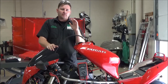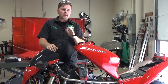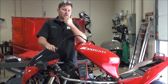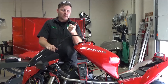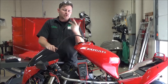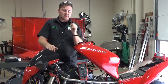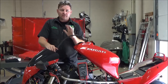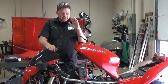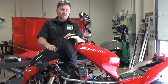I'm going to demonstrate today that we can use a voltmeter when we start a motorcycle and do three different tests. We're going to do surface voltage — that's what the battery is with no load on it. We're going to do a load test to see how far it drops down and give you some specifications for that. And then once the vehicle's running, we'll do a charging system test without moving the meter at all. We're also going to show how something can very easily be misdiagnosed.